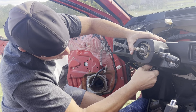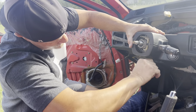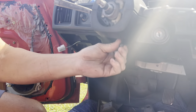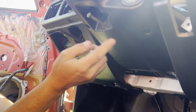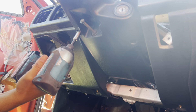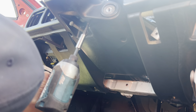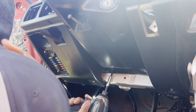If you still have one of these intact, go ahead and take off your tilt steering knob. If you don't have one, let me know — I've got them. Now we've got one, two, three, four, five screws in from the bottom, Phillips head. A long screwdriver, or if you have an impact or drill, that's best. One — let them fall out — two, three, and then the back two are at an angle.